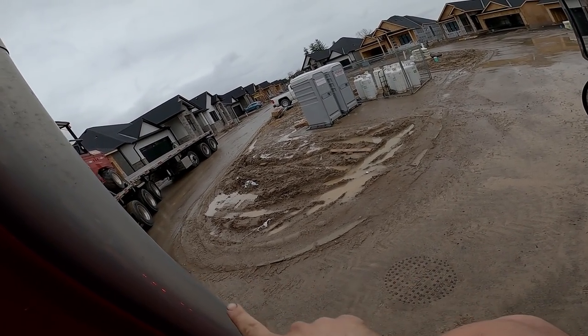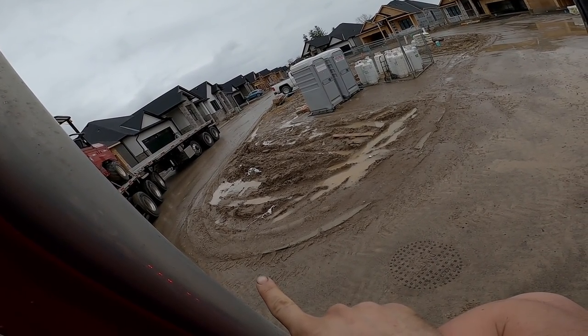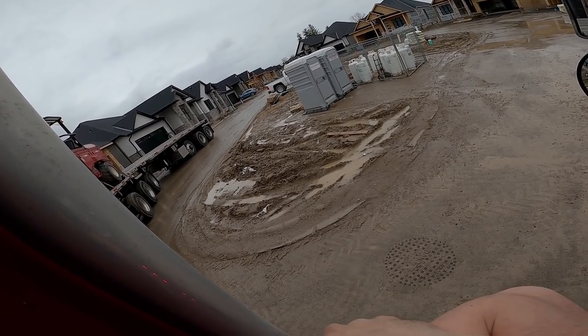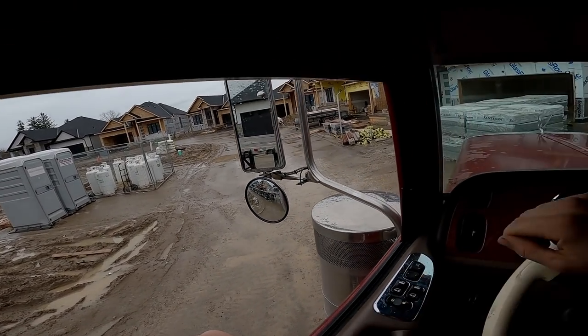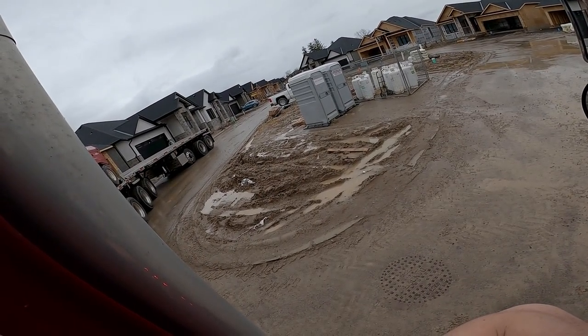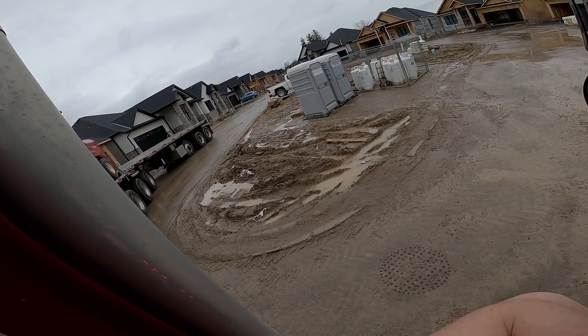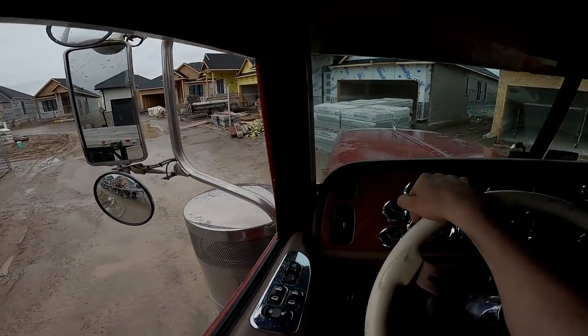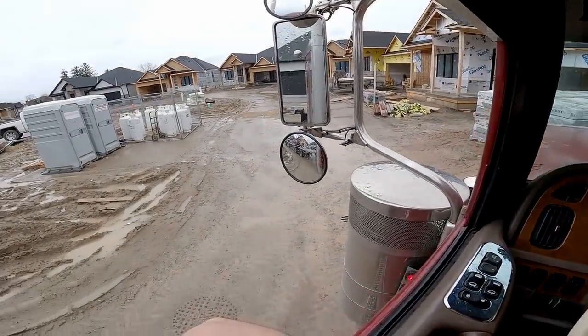Okay, look, that one little axle at the back is air pressure. It's not a leveling type one. You put in a specific amount of air in the bag and it lifts up the other two axles. So those are gonna drag. And the lead axle is going to kick the tri-axle around a lot.